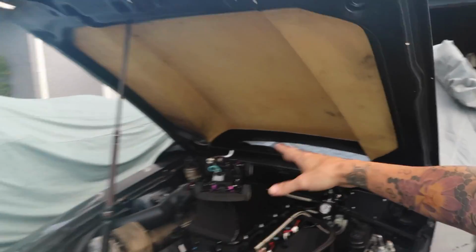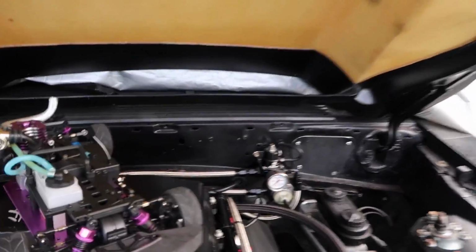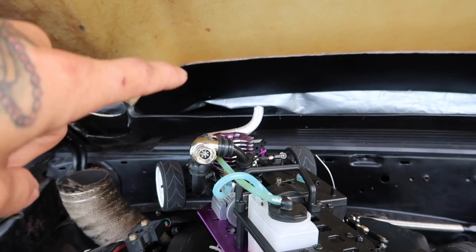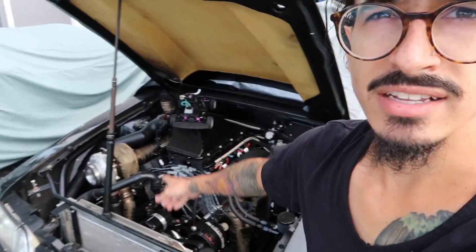And real quick, for all of those asking for the links in the description for the parts, there are no links, guys. I told you in the last video, this turbo kit is 100% custom. Most of this stuff I just had laying around from my real project car. And the only thing that you could find online simply is the turbo. I believe the part number is TK10R. That's the name of the turbo. So if you just Google TK10R, you should be able to find the turbo. But all the other stuff, guys, it's just standard silicone hose that I use for the blow-off valve and wastegate and vacuum lines and stuff like that. So I just pieced it together in my mind and figured it out. You can't really order all of this stuff specifically for the Nitro RC car.